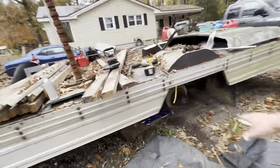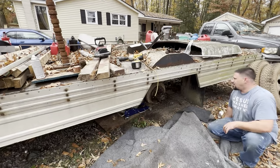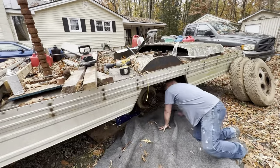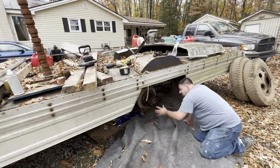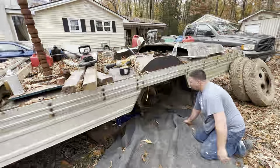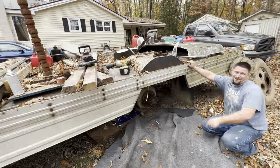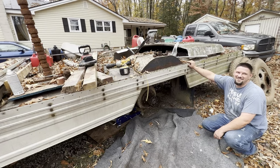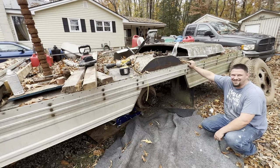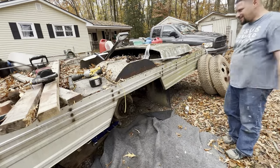I said we shove the lay it down device underneath there a little further. So your drums are part of the hub? Yes. Well, no, they come off, but from the inside. You gotta pull the hub off first. You gotta pull the axle out. All right. Then I may not have the big spanner wrench to get the hub nut off. You have the right tools. I do? Yes. Chisel and a hammer. All right, now we need to get that off.